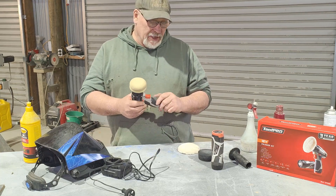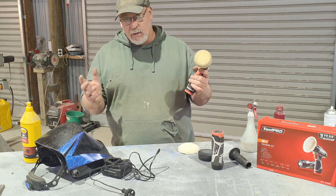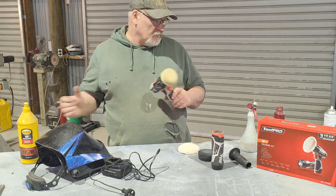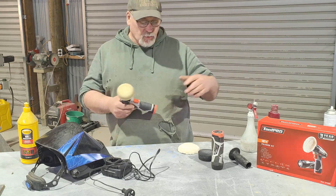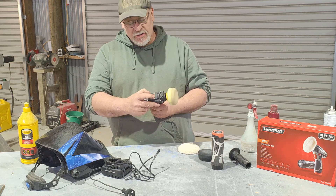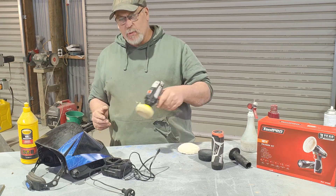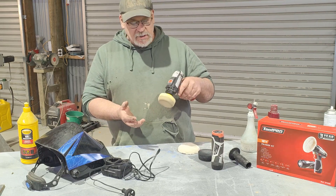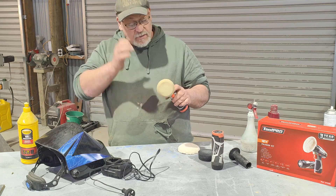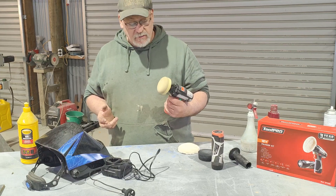I've had this for about a month or so and it's been awesome — a great little polisher. I mainly use it for restoring plastic headlights, you know, wet sanding and then going over with different compounds, like cutting compound and then wax cleaner. I recommend if you're not doing a lot of heavy work, just have it on the first speed. It will run on the second as well, but if you put a bit too much pressure for too long it'll shut off — goes into an overload. But it works fine and polishes nicely on the first speed flat out.